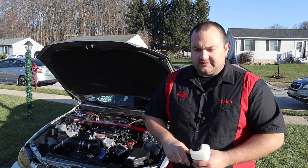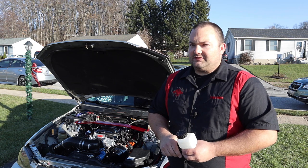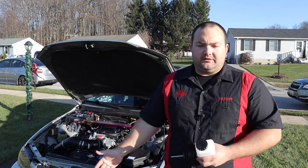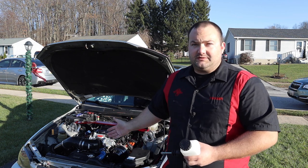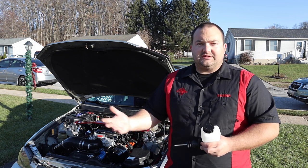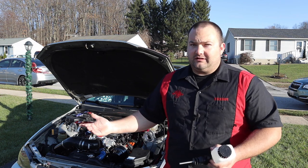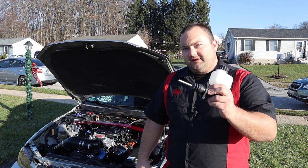I reached out to XAT Racing because they provided me with the bell housing, clutch, throw-out bearing, and all that stuff. They thought I had already upgraded my clutch master cylinder, which I didn't, so they recommend upgrading to this Tilton three-quarter inch bore master cylinder. It's possible that my old master cylinder may be going out — it does have a quarter million miles on it, so maybe some fluid leaks past the seal. I had a similar experience in my Supra where I put a stage four clutch in and it kept blowing out the master cylinder — I was using OEM Toyota master cylinders and the increased pressure kept blowing out the seals. So whether you're doing this swap or upgrading the clutch in your IS-300 with a 2J, this might be an upgrade you want to do.